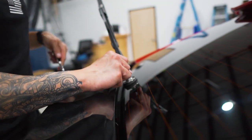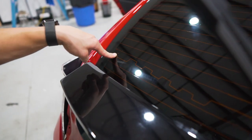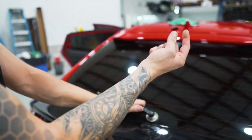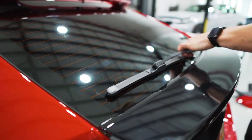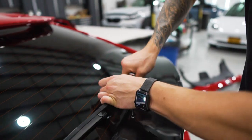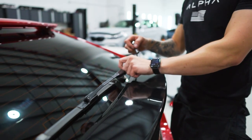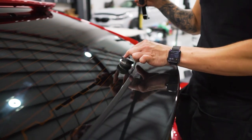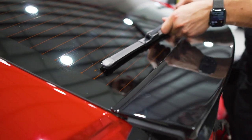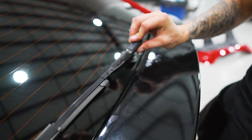Put the wiper back on. The position you want is so that when it's down, it lines up with the little line right here — that's what that line is for. What I've noticed is you want it to be a little bit lower than that, because when the motor engages it actually goes up then stops back a little shorter. Before you put the wiper on, you have to put this plastic piece back on first. Plastic piece on, wiper on, line it up a little bit below that line, add the 10mm, and then this cap goes back on.